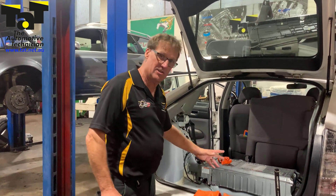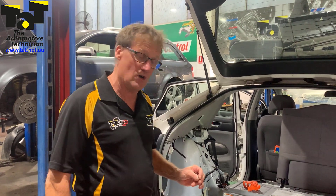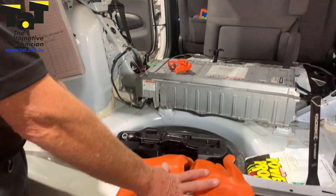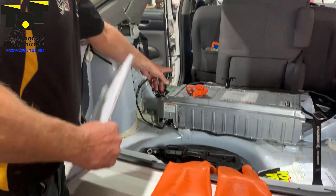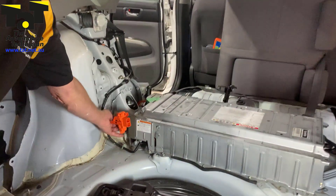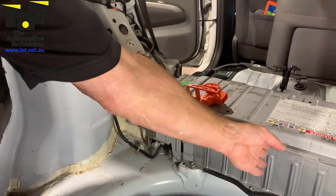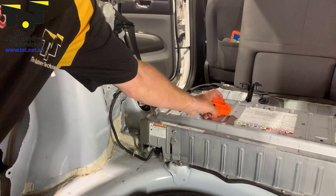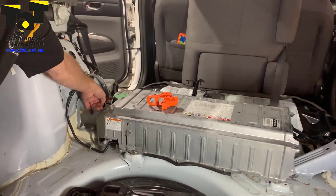Here's the high-voltage battery pack — it's a 2007 Series 2 Prius delivered here in Australia. We've stripped out all the things. First up, make sure you've got your high-voltage gloves if you're working on anything like this and you have experience with it. We've taken out the high-voltage battery plug, which lives in the side here, to isolate the system — that basically cuts the 210-odd volt battery in half. Next, we'll take this section off over here to remove the two high-voltage battery cables.